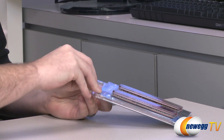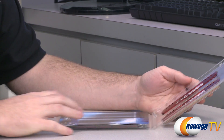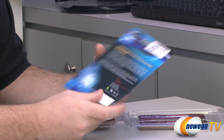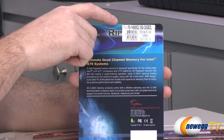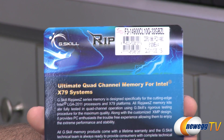If you really want to double check, you can check the motherboard manufacturer's memory compatibility chart, and as long as you have memory that's within that range or specifically listed there, that should give you a much better idea of what's going to be supported. We have some more specs as well as a detailed item number: F3-14900CL10Q-32GBZL.